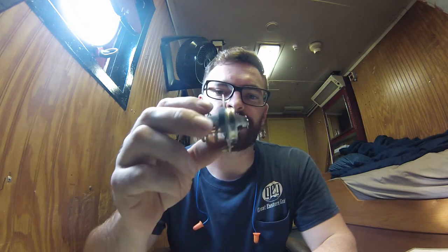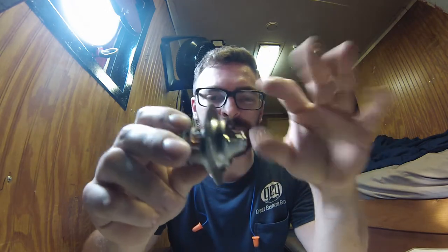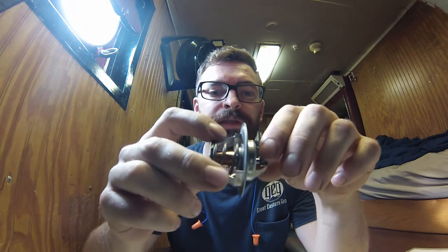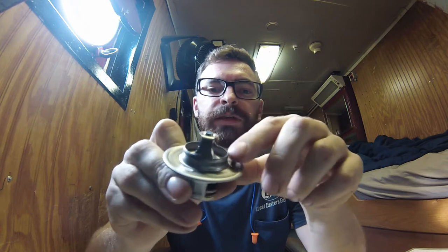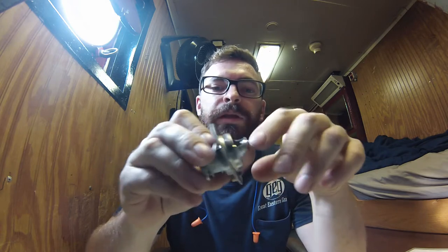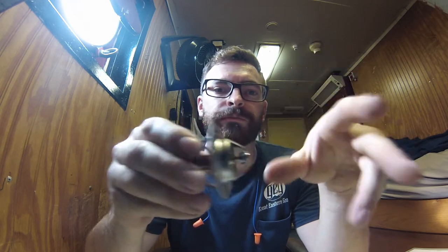But conventional engines, old engines, new engines — they all have these. Super simple, very reliable. The one flaw that people forget is if you overheat your engine severely, way over temperature, the wax in here will push out the seal. There's a little tiny seal in here and it won't work anymore.